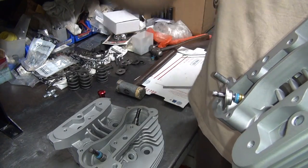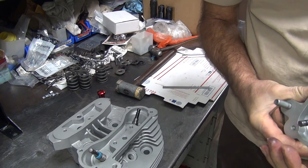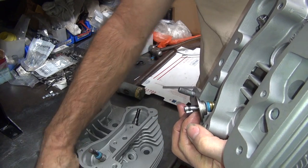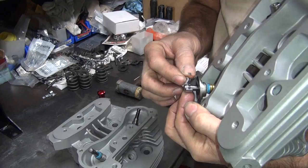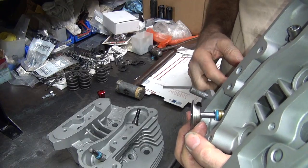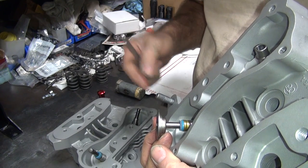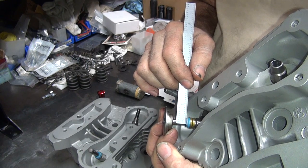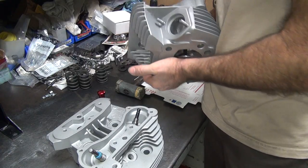Now you take your collar and two keepers — drop the collar on the floor until you have extras. You measure this distance right here and make sure you've got at least your valve lift plus 50 thou. In this case it's half inch lift — that's what this is — and we've got more than 50 thou there. You've got about another three-sixteenths clearance. You've always got to make sure you've got enough clearances on the seal.